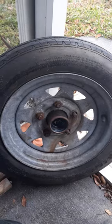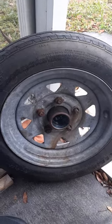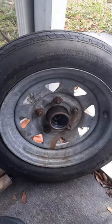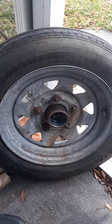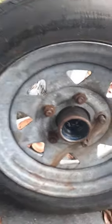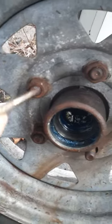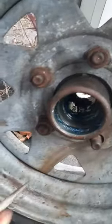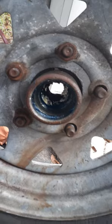The story today is about a trailer rim on my jet ski trailer. Whoever changed it last time just over-torqued the nuts until they started spinning — you couldn't get them off. This one, this one, and this one, and this one here. I had to pull the whole hub off just to get the wheel off.